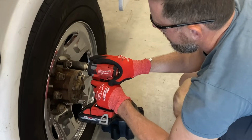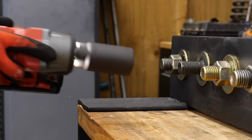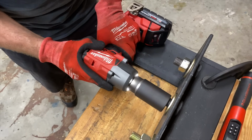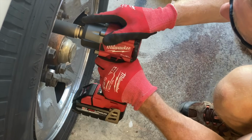And when we're working on vehicles, we'll usually use a compact impact wrench with at least 200 foot-pounds of torque for most basic work, but then we'll switch over to a mid-torque that's got at least 400 foot-pounds for doing lug nuts. One thing to keep in mind is that most manufacturers are going to market their nut-busting torque or breakaway force. That's how much it can actually loosen. For example, we have an impact wrench that can do 650 foot-pounds of breakaway torque, but only 450 fastening.